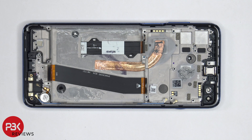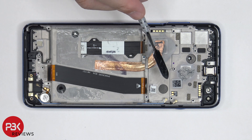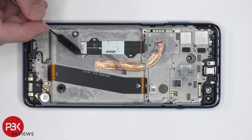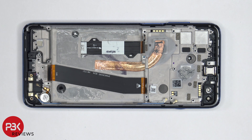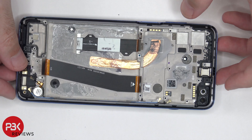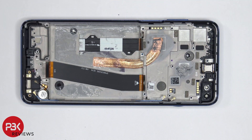Once the battery is finally removed, we can see this flex cable, which connects the main board to the subboard on the bottom, and the flex cable over here, which is your screen cable — it routes through this opening or slit in the mid-frame. So if you have to replace your screen, you'd take the back plate off, remove the screws, take off the top cover, disconnect the battery cable and the screen cable, and also remove the battery to gain access to the cable. Then you'd heat up the front of the phone where the screen is to loosen up the adhesive, pry your old screen off, apply new adhesive, reapply your new screen, and reassemble the phone.